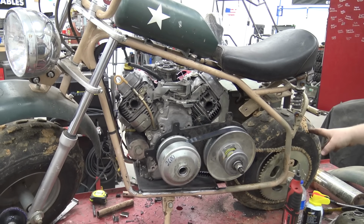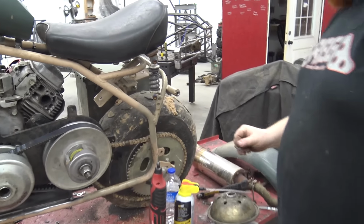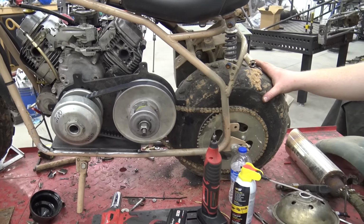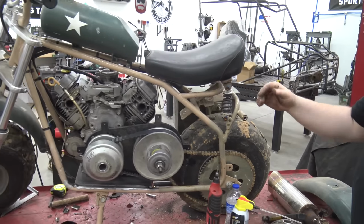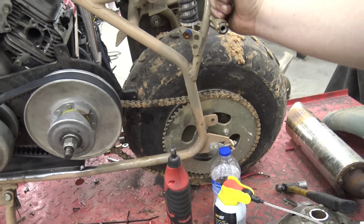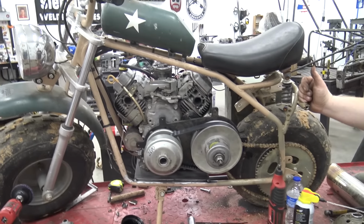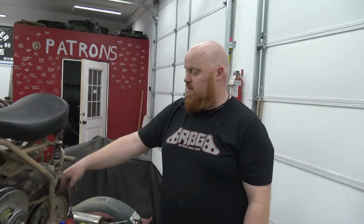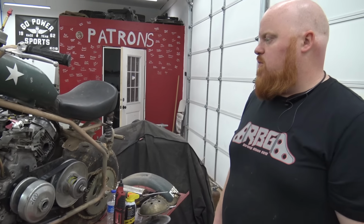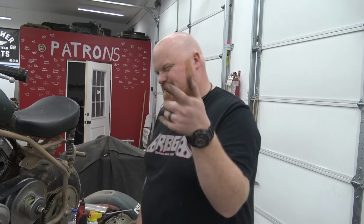It's gonna be sweet. We gotta order some tires for it too. This thing is bald. Yeah, they're rough. So we'll get the same ones we put on them. And we will do a swing arm on this bike as well. And the swing arm mini bike will be back. And probably gonna go with the smaller sprocket we were saying. That's a lot of teeth for a big torque engine. We're gonna have the power down low with a V-twin, so we can probably put like a 38 tooth on this rear. And this is 60, which will give us a lot better gearing. So we'll get everything together and we'll build the exhaust next. And I've got a pretty cool intake I'm gonna do. So we'll do it next as well. Let's go.